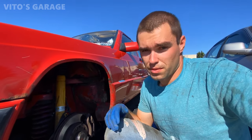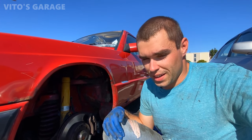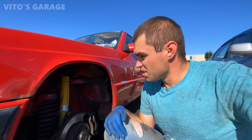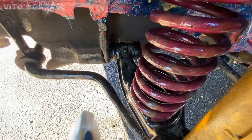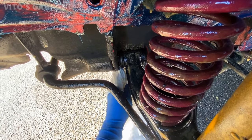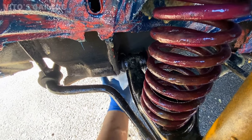I'm gonna get onto working on this car because I have to finish this side — already did the right side, this side is awaiting. I'm gonna be so happy and relieved after it's all covered up because I know my car will be protected. Once you're done, wipe down the rest of the fluid film off the rubber bushings and then coat them in silicone paste.